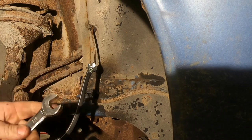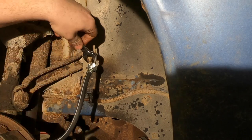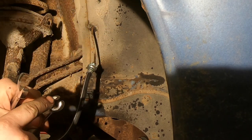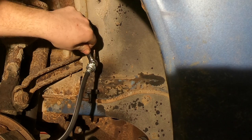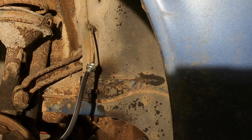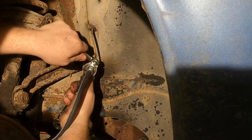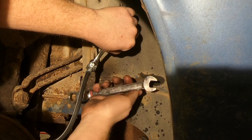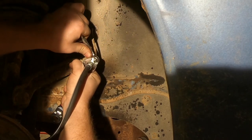So now the difference, you know, between a standard wrench and a flare wrench is, on here you got just this and this that are contacting the nut when you're tightening it. So that can cause slippage and round off the little fittings. Now with a line wrench you got all of it contacting, reducing the chance of slippage. So these grip on. These are, I believe, Sun-X tools. Got these off the Mac Tools truck, and they're reasonably priced. I've never had one fail on me yet, and they are quite awesome in my opinion. Because as far as I'm concerned, yes, the Snap-on ones are beautiful too, but if you're getting regular wrenches, I have Sun-X brand wrenches at work too that are decent, but nothing beats the Snap-on flank drive wrenches.